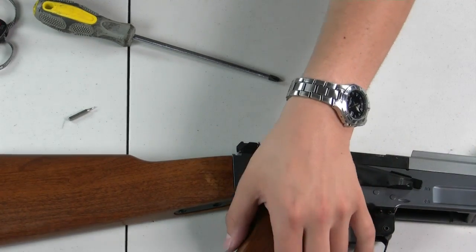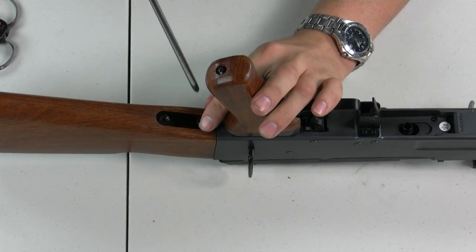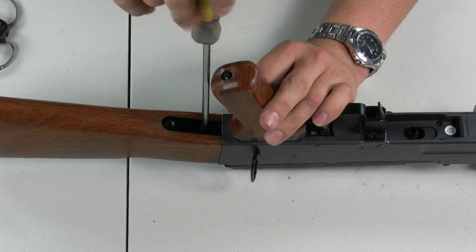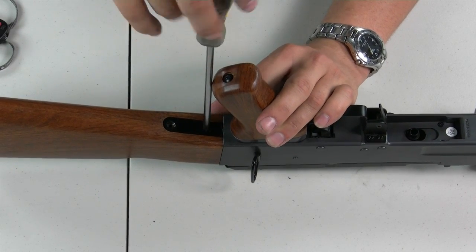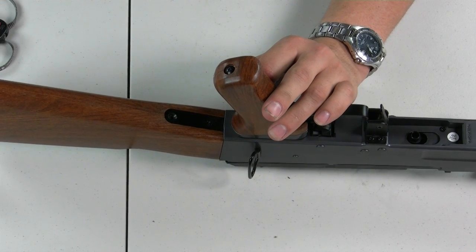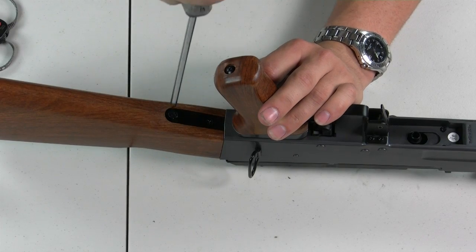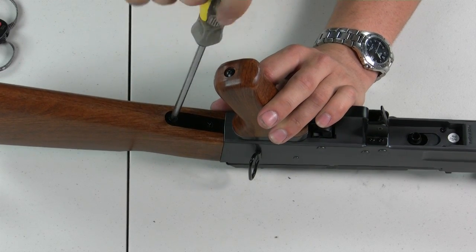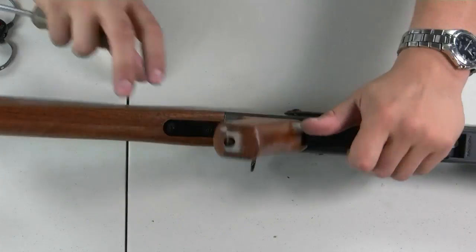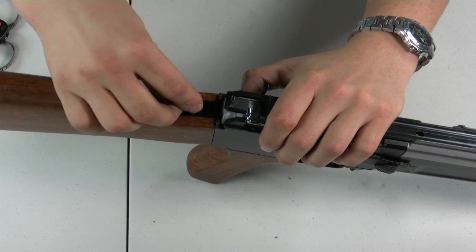And then you want to put your bottom screws in first, because there's more of these. A long shaft screwdriver should do right here. As I said before, it's advised you take off the motor cover if you have a precision screwdriver, because doing this at an angle proves to be a real nuisance. Like that. Put the top screw back in.